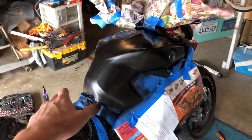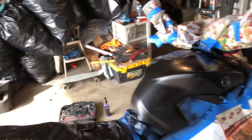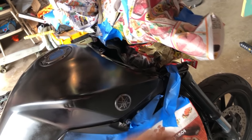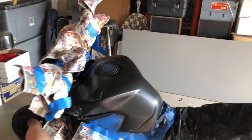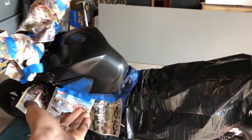The tack coat is applied. My plan is to put it on thick enough so that if it looks bad I can peel it off with ease. We're spraying over the badges into the plasti dip - we just peel it off after, simple as that. From here it looks pretty good. I don't want it to look like matte black - it does have some nice little sparkles, little glitter to it. That shine right there looks pretty good. I'm getting a little excited.